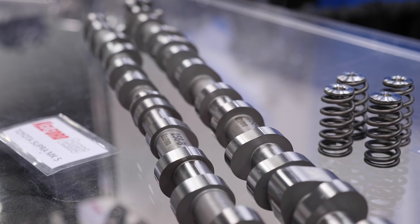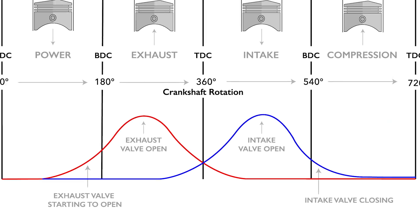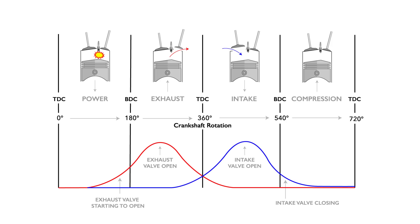The engine also runs a continuously variable cam control system, which is another consideration. For our smaller cam grinds, what we've done is keep the TDC events — so your intake valve open and exhaust valve closing points — much the same, and really shifted where the centre lines would be. Because everything's variable it's hard to pin it down, but we've affected the exhaust valve open and intake valve closing points so that while the engine's still fresh and not a lot of parts are available, the piston to valve clearance should be much the same while still achieving increased performance.